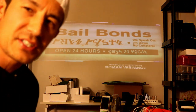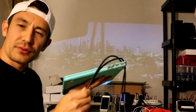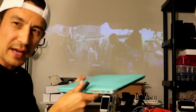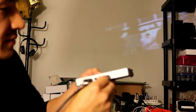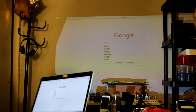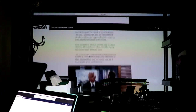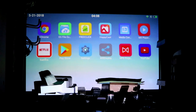Let me turn off the lights and show you how to connect this directly to a laptop via HDMI. I'm using my MacBook — note that an HDMI cord is not included so you'll need your own. Plug one end into the MacBook and the other into the HDMI port on the back of the projector. Here's my MacBook now showing on the wall.